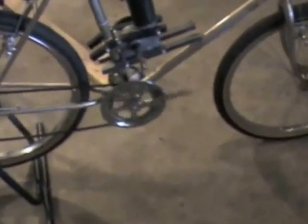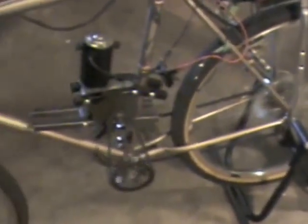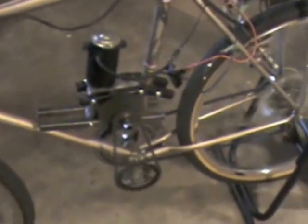I need to gear it down more so it goes uphill around this area. The sprocket on the motor is actually a real freewheel sprocket, so it allows you to disengage when going downhill — that's the trick to being in compliance with the European standard, solving the problem of freewheeling. I actually tested the bike out for two hours later on.